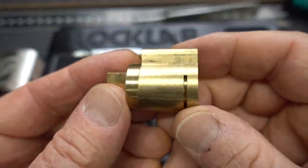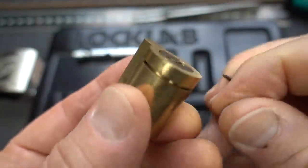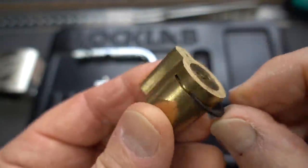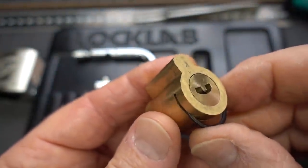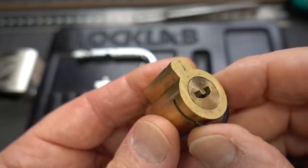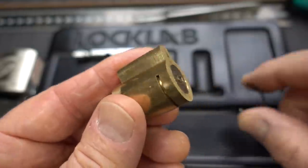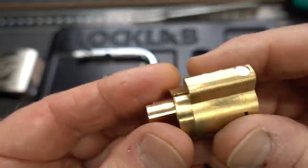All right, this is starting to get kind of interesting. There is a small circlip that fits in that groove there that holds the inner, well, actually there's more to this than what we thought. This actually has three sleeves. So it holds the outer sleeve to the middle sleeve. Let me show what I'm talking about. So when we take that off, we can slide this dude off.